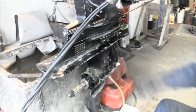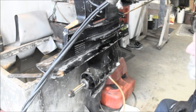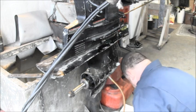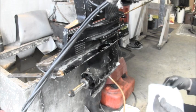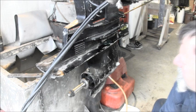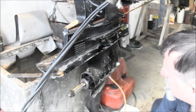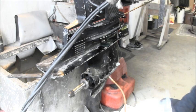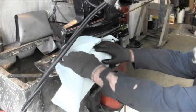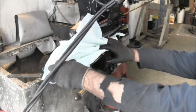And there comes my oil out there. Now you wanna get slow at this point and get them bubbles out. See them bubbles? You wanna keep pushing, have your rags ready. And just push a little more to get most of that air out of there. There we go. She's looking pretty good right there. That's got a good flow to it. So let's get that out of there and get my top screw back in.